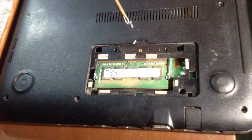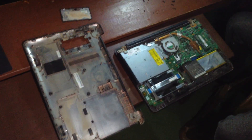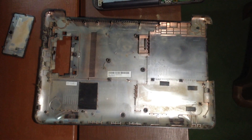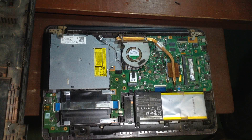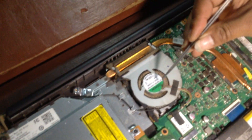There can be multiple reasons why a laptop makes a whirring noise. The main reason is your fan collects dust inside it. Another reason can be your laptop is old and the fan motor alignment is imbalanced. If your laptop makes a whirring noise on start and after a few minutes it stops, that is a symptom that your fan should be cleaned as soon as possible, as the fan can produce a louder sound over time.